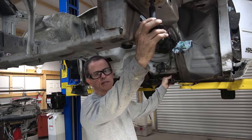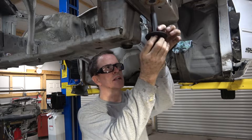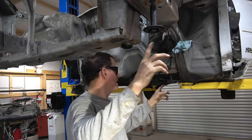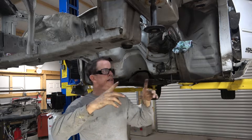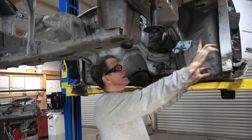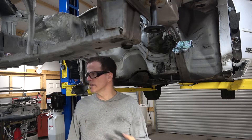I have to pick up the four points on the bottom for the engine cradle. To do that, I've just cut a piece of half-inch tubing — same thickness as the engine cradle — that will fit up into the hole in the chassis. I'll run the bolt up through and tighten it, and then it'll be locked up against the nut. I'll weld the cross brace between this point and this point, same on the other side, and then come across with something that X's it so that it won't twist. Then I have to come up to the strut tower, and that'll give me all my points that I need to put it into the other car.